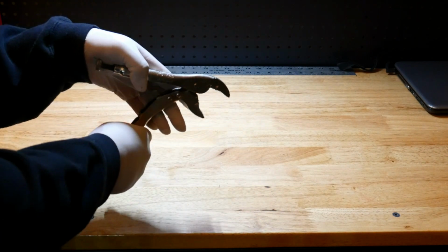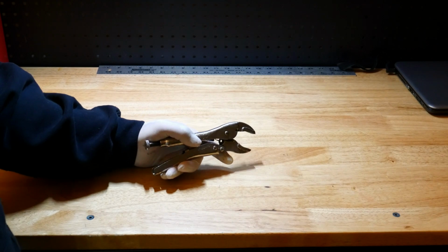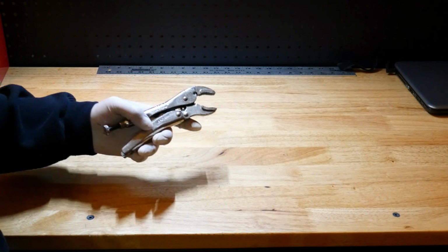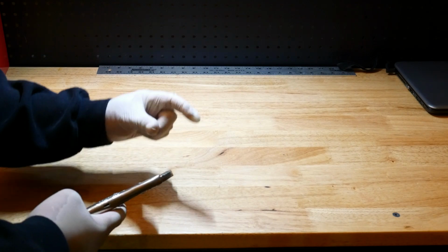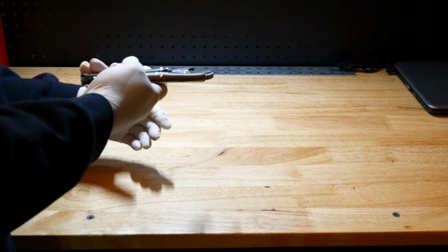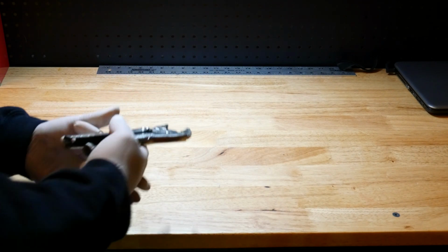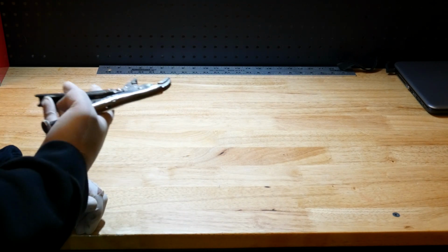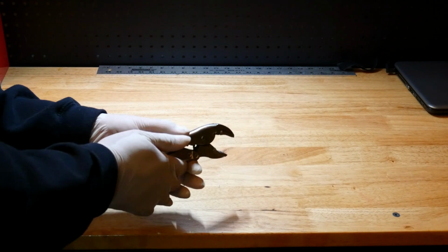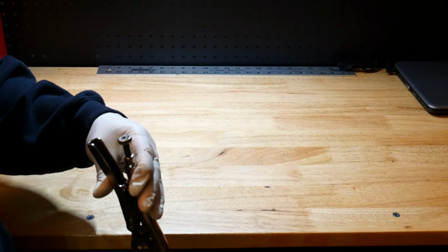We all know you clamp on it and you got to work it down that hose until you can slide that spring clamp down away from the sealing surface of the hose and the spout so you can get it off. Well, a lot of times spring clamps can be pretty wide, and those ones are difficult to hold in place and try to work it at the same time while keeping tension on it. And a lot of times you'll slip and you'll lose it, and try it again, you'll slip and you'll lose it. So I found a pair of vice grips will keep those spring clamps locked for you, and once you get it locked with the vice grips, it'll stay locked and you can slide them down.